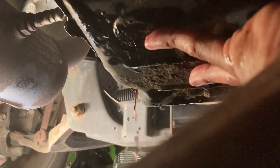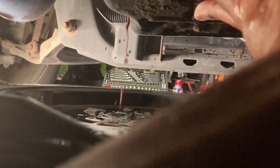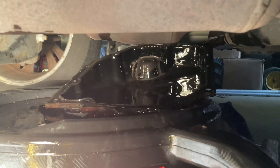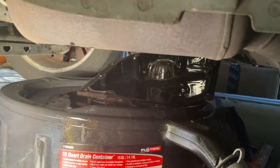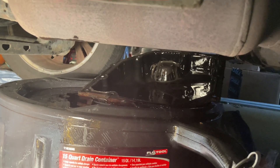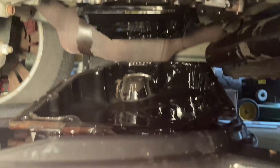This is what I was trying to do — have it go towards one corner and drain out. So I'm going to let it drain slowly, fill up this drain pan, and then take a bolt on this corner out. So the pan is down, I'm going to let this drain for a little bit. Then we're going to pop that filter out and put the new filter in, clean everything up, put the new pan back on, and get some new fluid. It was definitely time for a filter and fluid change — this is looking pretty gnarly in there.